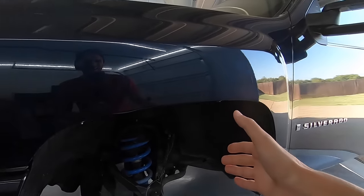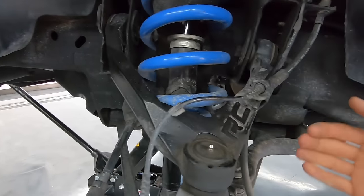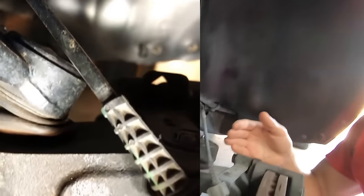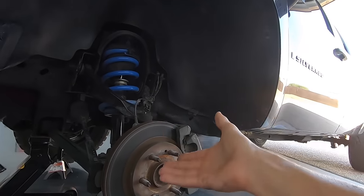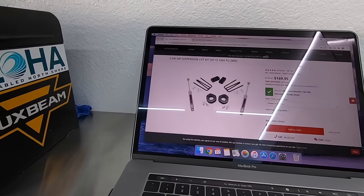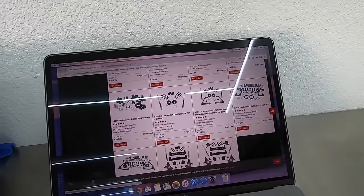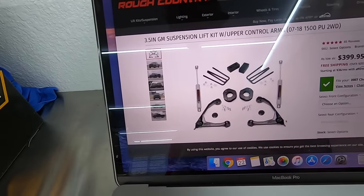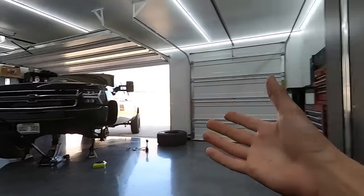So step number two of this lift level kit was going with the forged upper control arms. These are massive and beefy — really no worry about shearing or breaking. What Rough Country did was fix this ball joint angle. Comparing side to side, this is the new ball joint angle at full droop — it was a night and day difference. A little stiffer than stock, which is fine, but there's still that articulation. Going back to Rough Country's menu for this particular truck — the 07 Silverado — it looks like they've updated their overall suspension lift kit to include these forged upper control arms. Their price right now is $399 and they do come with the forged upper control arm. This was not available when I initially did it. If you're going to buy this kit, I highly advise getting the one with the upper control arm.